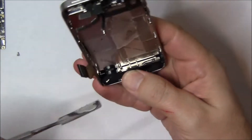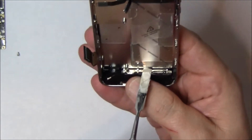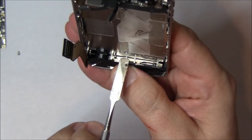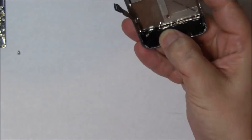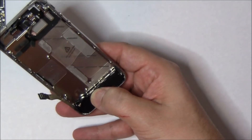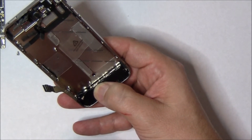The assembly has these tiny little tabs at the top that you actually have to push down so they fold down. Try not to break these, because they help hold pressure on the dock port. There are four of them. Once you get them set down in there, the dock port should sit flush. There are two screws and a little plastic tab that hold in the dock port — the screw on the right is the easy one, so put that one in first.